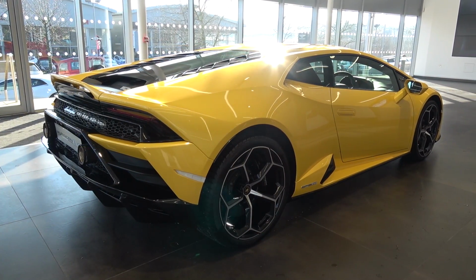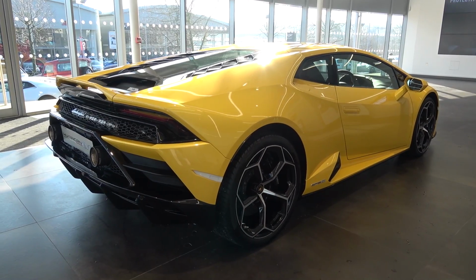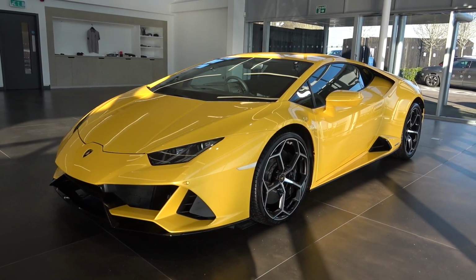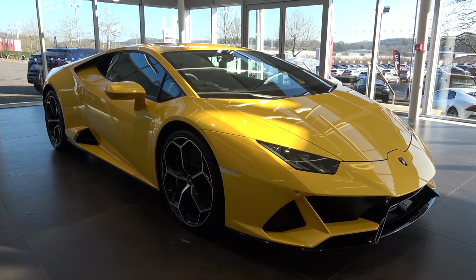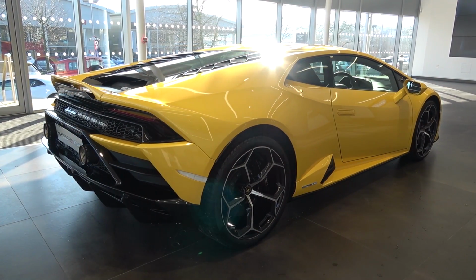Based on a hybrid aluminium and carbon fibre chassis with aluminium panels, Evo comes in at 4,518mm long, 59mm longer than its predecessor, 2,236mm wide including the mirrors, 1,165mm high with the standard suspension, and has a dry weight of 1422 kilograms, with a distribution of 43% to the front and 57% to the rear.